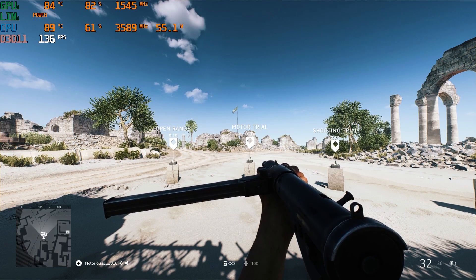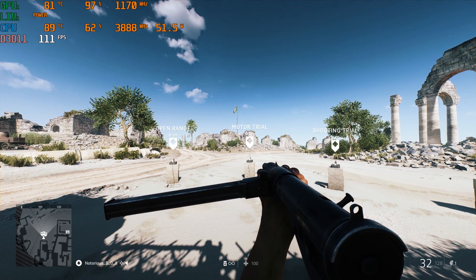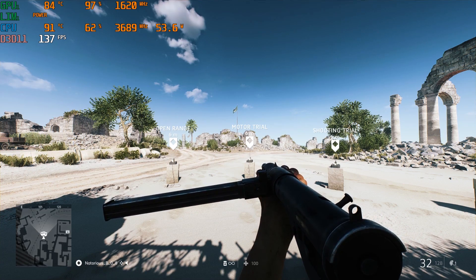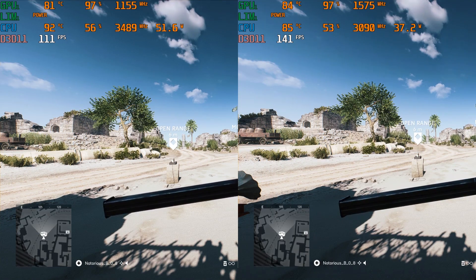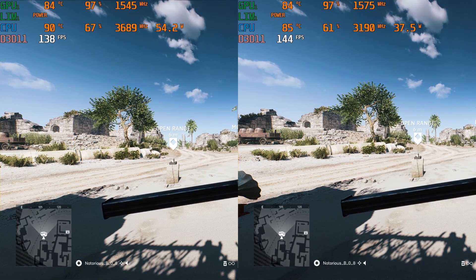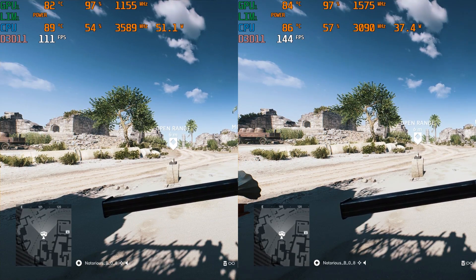Running maximum performance with max fans, you will see the RTX 2070 Max-P in this chassis thermal throttle. Once it hits that 86 to 87 degree thermal throttle threshold, the temperature drops, the power drops, and as a result the frame rate drops — and this will go back and forth indefinitely. Now, while the performance drop is not as bad as on other laptops, applying a GPU tune can go a long way. As you can see, we now have maximum temperatures in the low to mid 80s, just barely out of range of thermal throttling, and the frame rate performance is higher than it ever was at stock. On top of that, running the middle performance profile on the CPU limits wattage to 45 watts — something it does on its own. This was a really nice balance to get maximum performance from this chassis with very little compromise. Let me show you what gameplay looks like now featuring this tune.